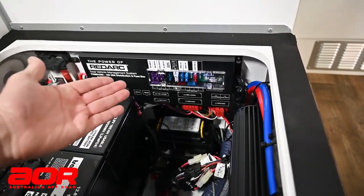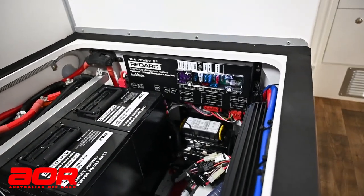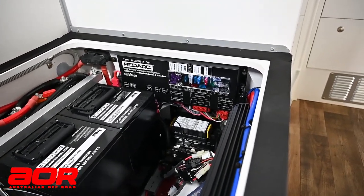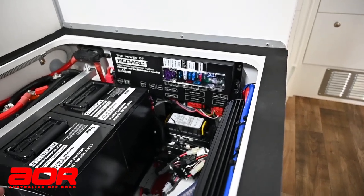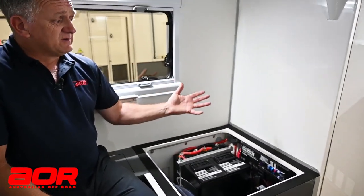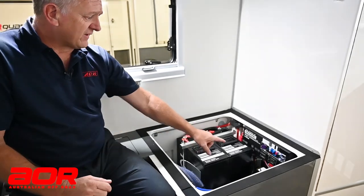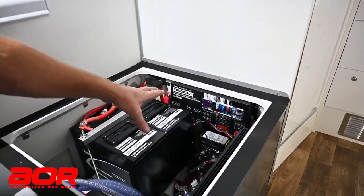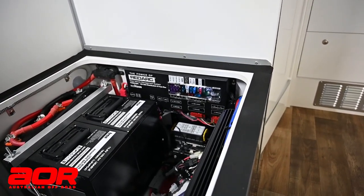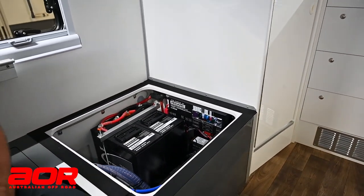One of the key points is our fuse boxes. There are four fuses and another smaller fuse down the bottom. They're laid out very similarly — one is what we call our 12 volt supply, and the other is a 24-hour supply. The 24-hour supply is for things we want power to all the time: fridges, toilet — things where you can access them without turning the main switch on. The top fuses cover all the other bits and pieces like 12 volt sockets and the radio — things you turn on intermittently. Everything is labeled throughout all the fuse boxes.